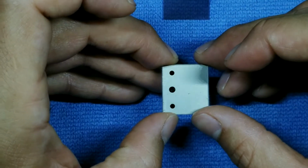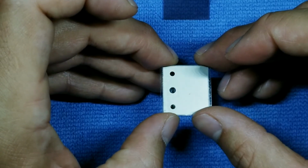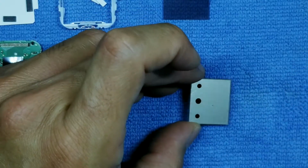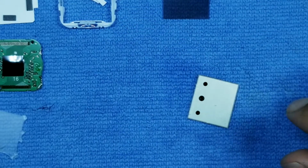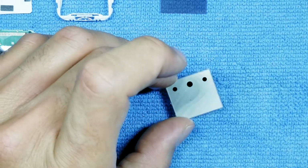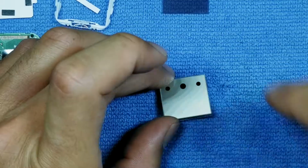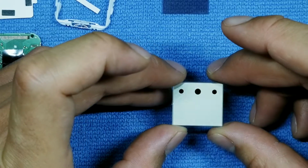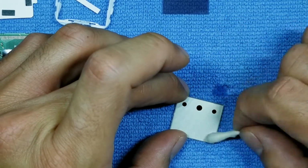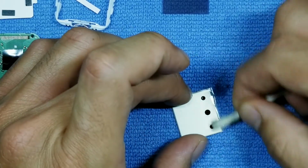So turn it in the light every now and then. You want to get this as clean as possible. You'll also start to listen to your Q-tip. The Q-tip will start to make a squeaky sound when it's hitting that clean display, which kind of tells you you're towards the end. So I'll check back with you guys once I'm done. All right, so I've been doing this for about 5 minutes. Looks a little bit better. One thing I want to emphasize, make sure you focus on the edges as well.